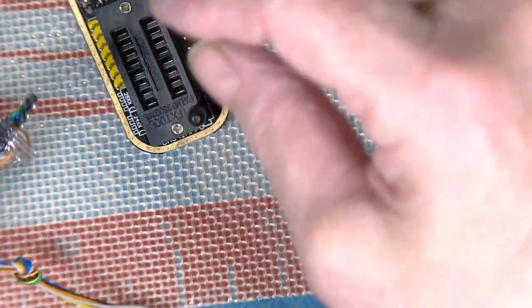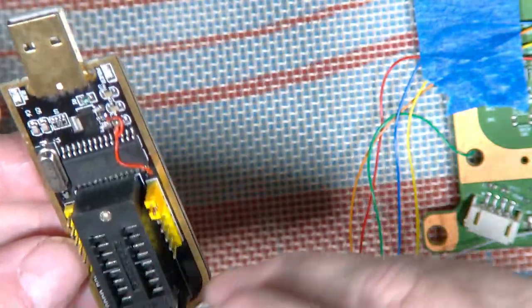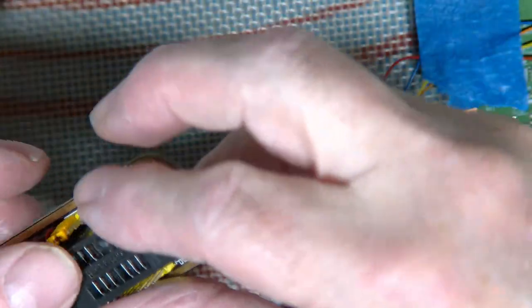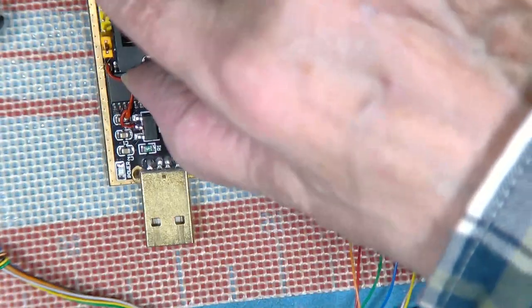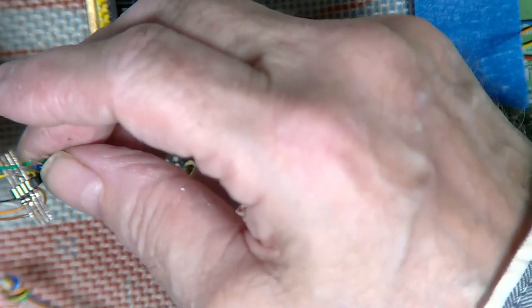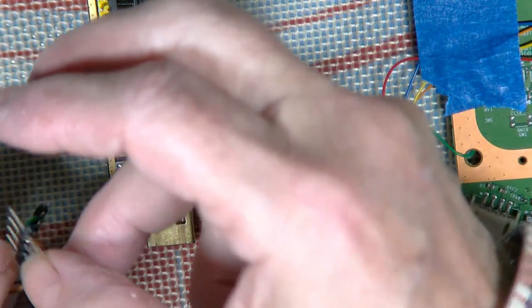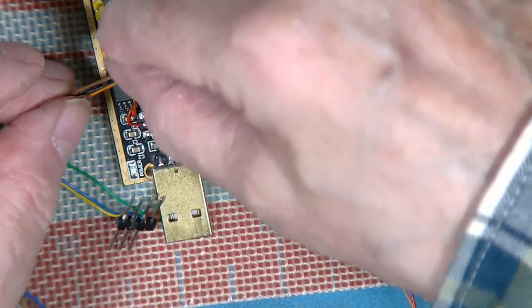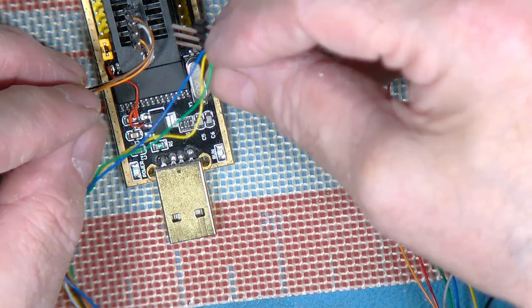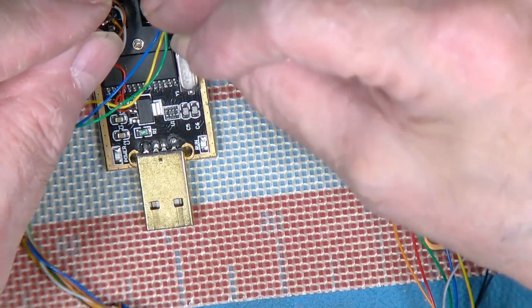So what we'll do, we'll give this a try. Now, the SPI is the socket nearest the USB, and pin 1 I believe is nearest the noddy. Yeah, I don't remember which way around I've done this now. Pin 1 is brown. Always use colour coding, resistor colour codes for wires to numbers. So that should go in that side. And then that one's got no supply on it because we're putting the supply in ourselves. 5 is, you know, it's 5, so that'll do that.